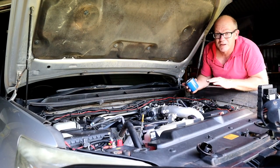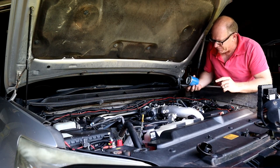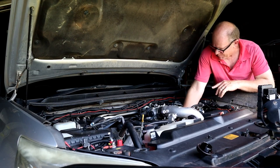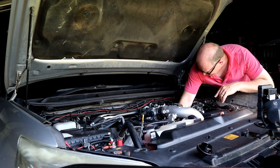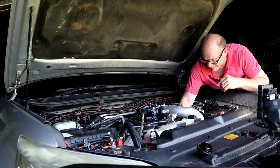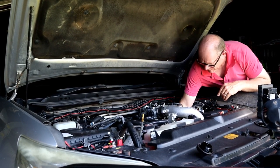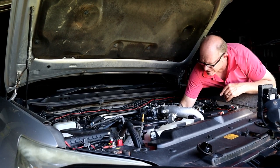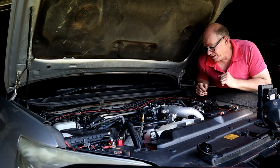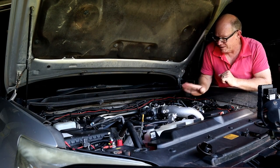What that does — and I'm not a mechanic, but — it just keeps it nice and moist and helps it not get tight and brittle, and saves you having problems when you go to take it off for the next change. It's just in reverse — just be really careful, you don't want to cross thread anything here because that will cause you plenty of dramas. Just nice and carefully feed it back through all these pipes, being careful not to get yourself caught on those sharp clips. Down she goes, back where it came from, and you tighten it up. I just get it tight by hand and give it a little bit more — that's all you need. Oil filter is on. We can tick that box.